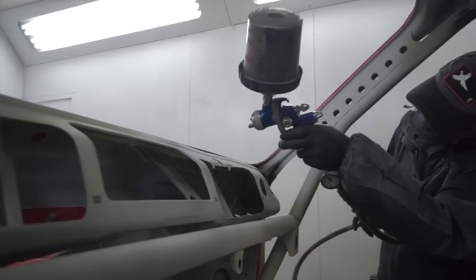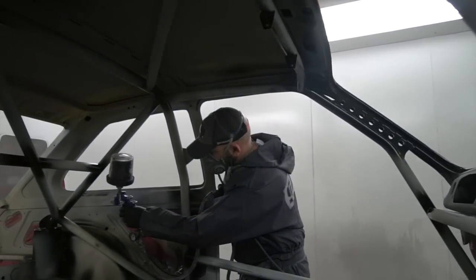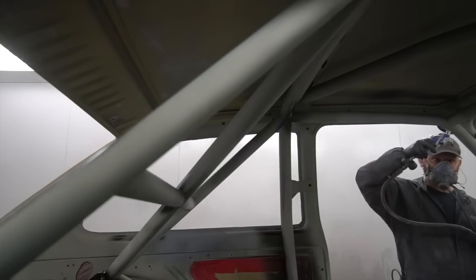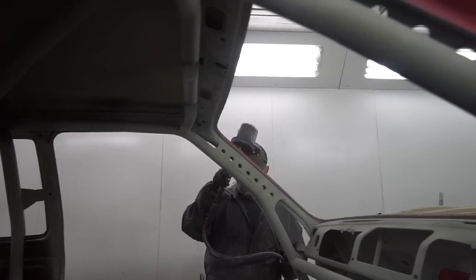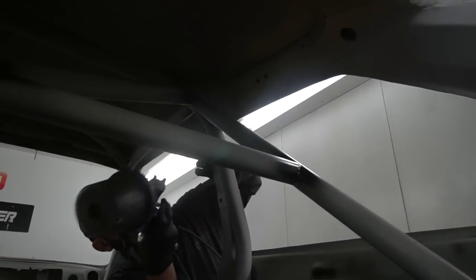we've got a sealing coat on all of the outer bodywork. Actually, Gaz, thinking about, presumably engine bay next, are we? Yes, I'm just checking with Gaz, because I was about to say we're ready for wet flatting the outside of the car, but we're not actually. He's going to paint the engine bay next, because the engine bay is all prepped. We won't be wet flatting that. There's no point wet flatting that. That will be dry flatted. Then paint the engine bay.